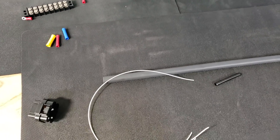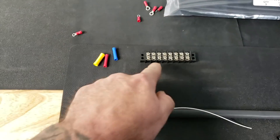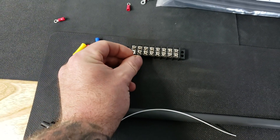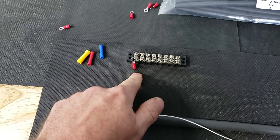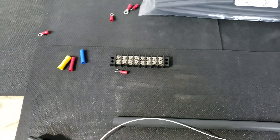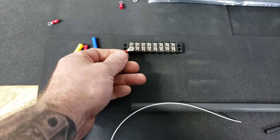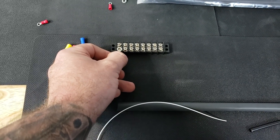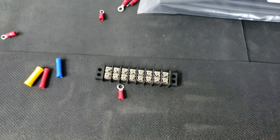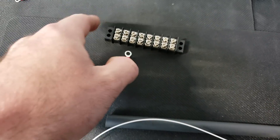There are a couple different ways to go about this. The first I'm going to show you is not something I would recommend, but a lot of people use these and have good or bad results. You run 5 volt in and then jump across all of these terminals, and now you've got 5 volt across all of them. You would run your 5 volt out of the ECU to a ring eyelet terminal, hook it up here, and jump across all of them. They make little bridges for these things — I don't have any here because I don't ever use them, but I pulled this one out of a car to show as a demonstration.